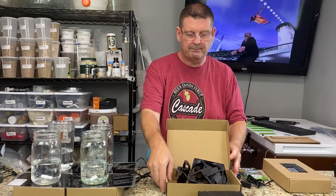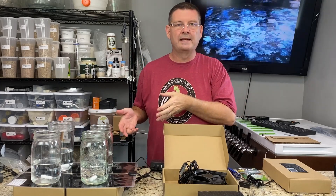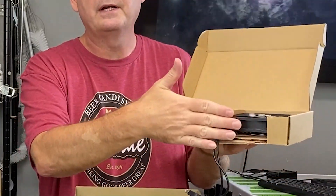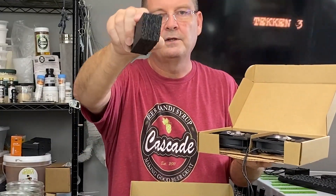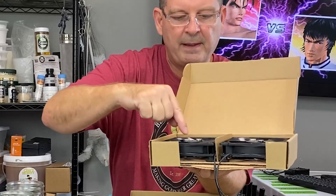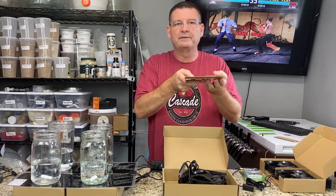The box that the unit came in — you're going to use that box. The first two I built back in July 2017 and I've been using them since; over three years old and not a single problem. You're going to need to cut some cardboard. I've pre-cut some here — you cut one piece off the front to use as a measure, and it creates a bridge. That bridge holds the top of the cardboard up so you get that little bit of space above the magnets that you need. Cut two other pieces to go under the fans to lift them up off the bottom.